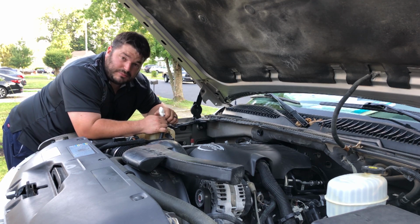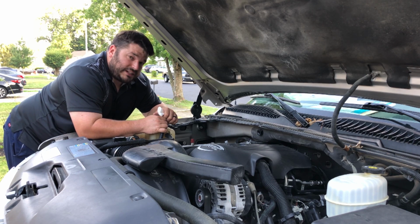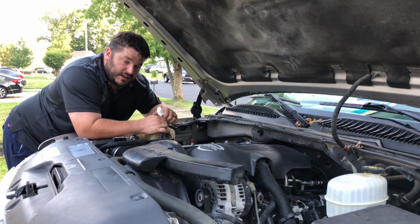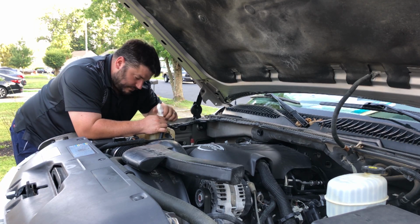This one is a 15 psi. So the coolant system's under 15 psi. Well, at 15 psi, that raises the boiling point over 212 degrees. So with the coolant sitting in your engine at 230 degrees, and you release the pressure, your boiling point instantly drops to 212, which makes all of the fluid in the system boil at once, instantly, which is what creates the geyser and will hurt you badly. So when I say do not take the radiator cap off of a warm vehicle, don't do it. My vehicle's not warm, so I'm going to take it off.